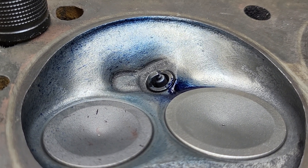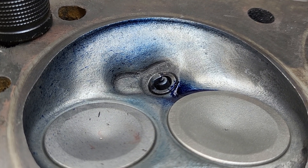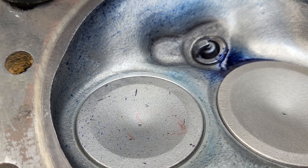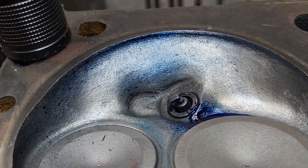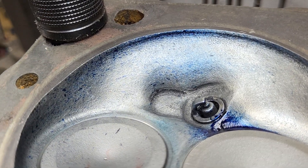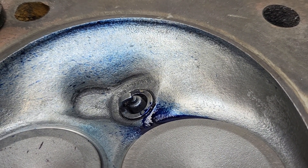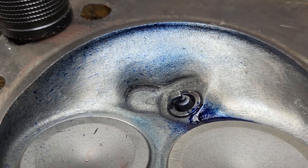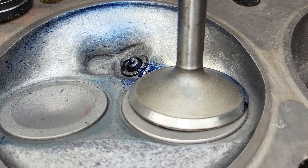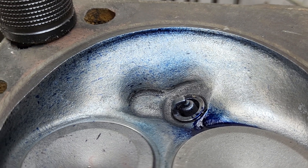Okay guys, 318 mission impossible. The only thing I changed is I textured that intake valve. I wanted you guys to take a look at the splatter across the exhaust valve, the splatter across the chamber. Remember what I said — the texture might be the best of both worlds. You may only lose a touch of flow but you'll regain some of the advantages that this valve with that evaporation ridge had as far as liquid control.